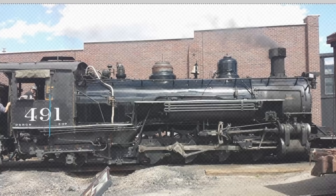So that's level two. How do those rods and the piston actually make the locomotive move? Inside here we have the piston. The piston is connected to the piston rod, and this connects to the main rod. The main rod is the big one that connects the piston to the driving wheels. If you only had one wheel, you'd connect to that one wheel and the main rod could just drive it. But we have a lot of wheels.